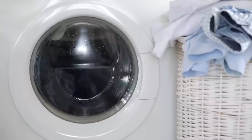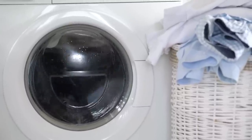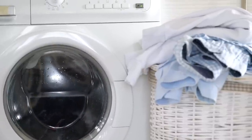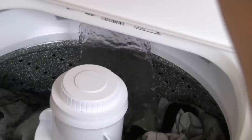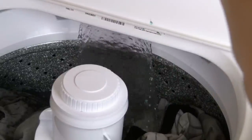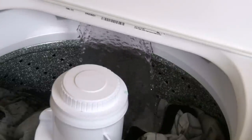One thing to keep an eye on with front-load washing machines — in the bottom of the boot they should have drain holes, and if those are plugging up with detergent residue from over-consumption, hair, Kleenexes, or sand, that's a problem. Also, don't run cold washes if you're using detergent — it does not break down. If your incoming water is over 80 degrees, then by all means run cold, but otherwise you need warmer water.